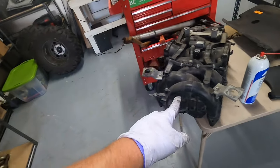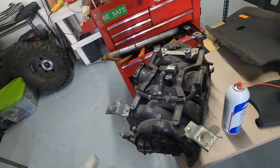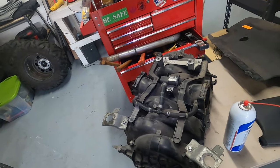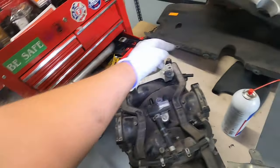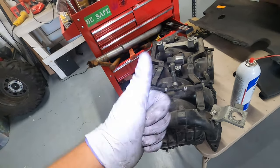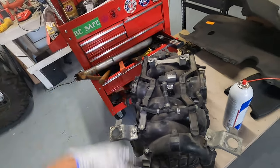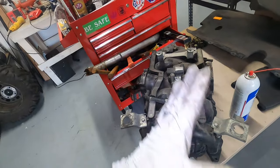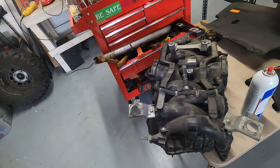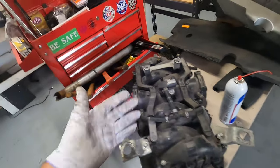What I'm going to do is put this intake back on, throttle bodies back on, intake back on — not going to tighten everything down 100%, just enough to where I can run the seafoam through these two ports and see if we can get some cleaning action on those valves. If we do, that might save everybody a lot of time, money, and resources from doing walnut blasting — because you can get that direct injection of seafoam, BG44, or whatever chemical you decide. Chevron has an additive with the PEA additive that's supposed to break down carbon — you could even use that.